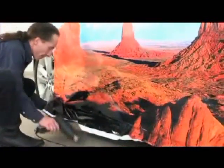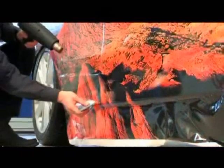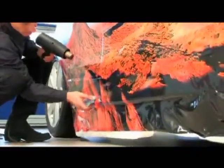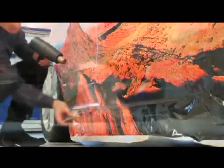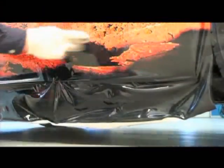On the sill, the vinyl is heated in large sections with the hot air gun, then pulled slightly downwards and attached carefully. By alternately applying hot air and smoothing out the vinyl with the squeegee, the vinyl is now applied using hand and finger pressure with the assistance of hot air, to the concave and rebated areas of the vehicle.